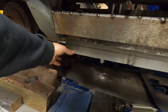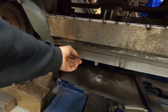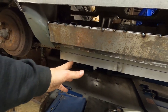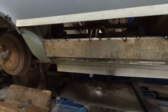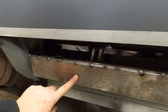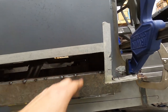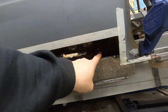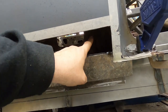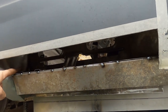I'm not going to tack this in just yet because I want to make sure I get the inner rocker welded nice and solid from the inside first. It's pretty much all tacked in there right now, but I want to make sure everything fits before we finalize. Outside here this has got a little scale surface rust on it, and I went ahead and wire-wheeled up in here today — there's a lot of surface rust starting on the components in here, so I did that.